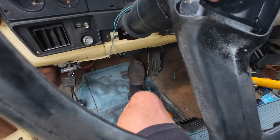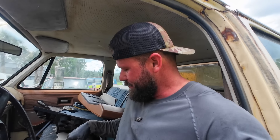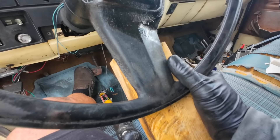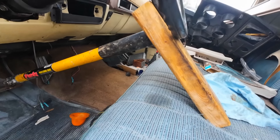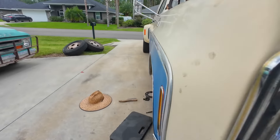Let's get these wheels on. My little bottle setup thing wasn't working at all, so I had to shift gears. Got a new technique — pumping the brakes about 10 times, getting a lot of pedal feel back, which is really nice. I got my old painter's extension here and a piece of wood. I'm putting my piece of wood up on the steering wheel, just wedging it in there, keeping good pressure on that pedal. Then I'm running over here — still got the bottle set up.